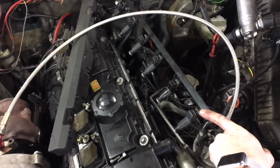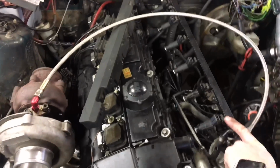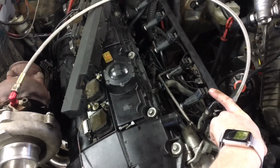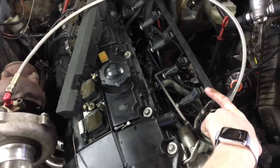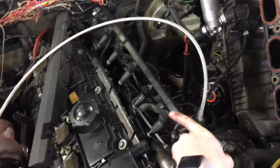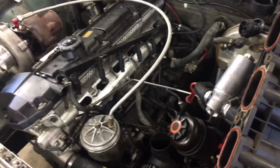I might just have to order a new set of 60-pounders and call it a loss, but I'm tempted to throw the green tops I have, I guess they're on that harness right now, and just get it running with the 17-pound injectors and then sort this out, replace them later. I'll figure that out once I get it back together, but right now still working on the harness. Bummer though. Well, she's naked once again. No harness whatsoever.